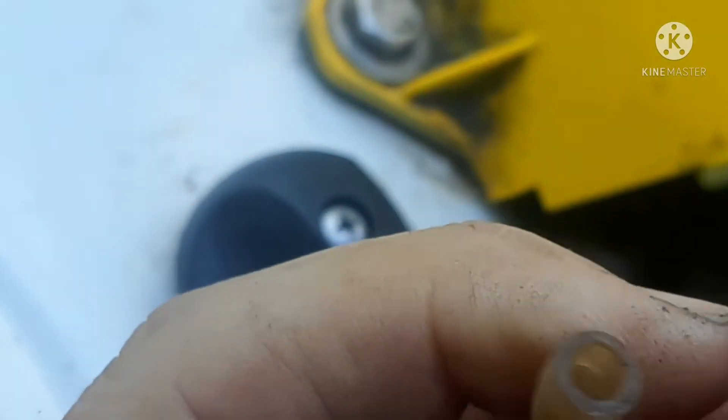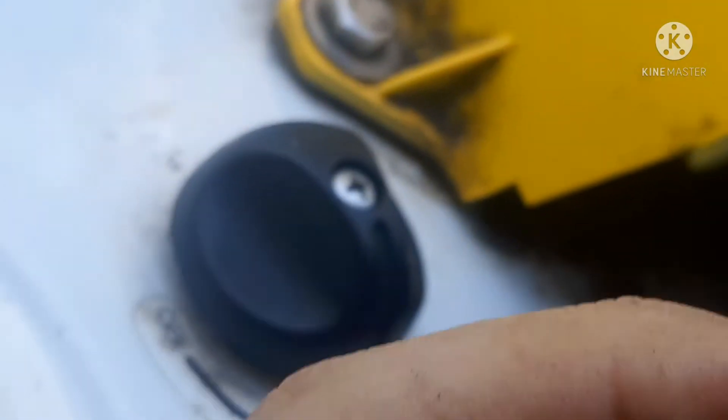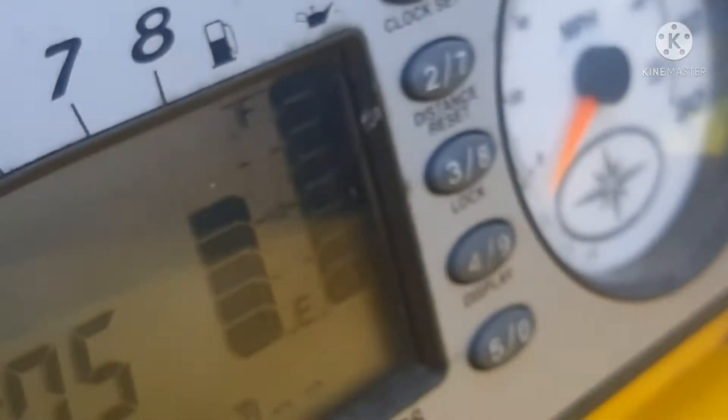These are known to be bad — I hear about getting sand and stuff in that pitot. I can blow all the way through mine. They say you can get a crack in the tube and it won't work. I can't get my speedometer to work, but when your speedometer isn't working, it could be that, or your mechanical speedometer is just done for.